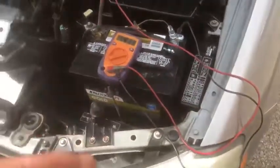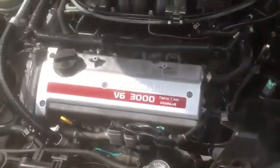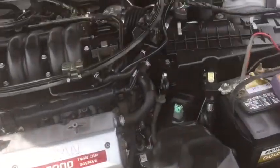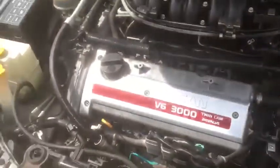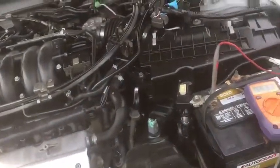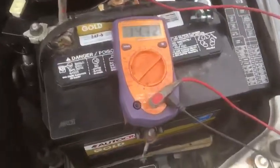So we've put a battery in this, we've also put an alternator in it. I had the alternator checked — it actually was bad — but even after I put the alternator in it just didn't quite stay at 14. I actually went ahead and put a second alternator in it and again it was above what it was before, but it wasn't quite where I wanted it. I wanted 14.